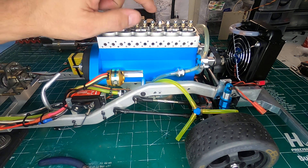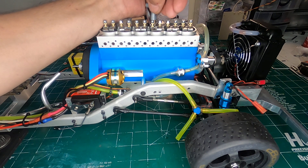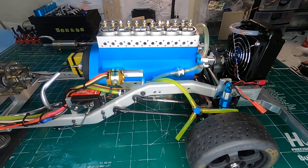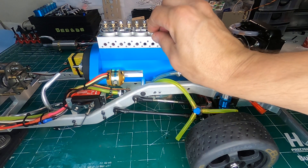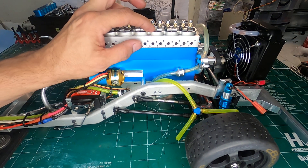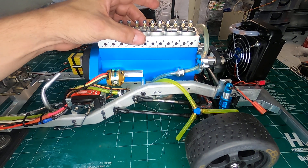Right now I do have a little binding on the intake valve. So I can take my pliers, hold the brass slave nut, and do an eighth of a turn. Now I can tighten the slave nut into my lock nut, and then I'm going to go and feel that I do have movement again. Now I'm going to go ahead and keep opening — it looks like I'm at full stroke, and I have a little bit of movement there. So full stroke, but no binding.